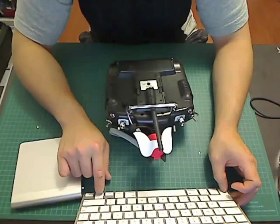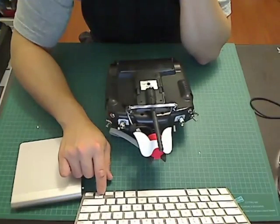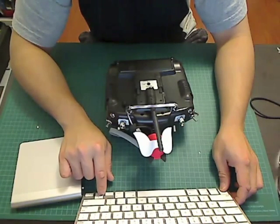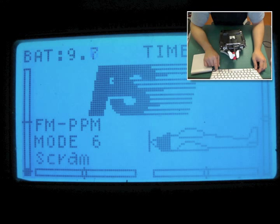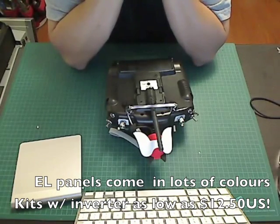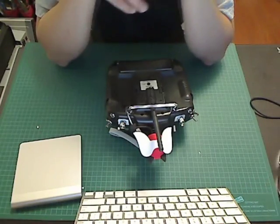Once you're done, put everything back making sure it's tidy and nothing is in the way. Heat shrink everything so nothing gets shorted — or use electrical tape if you don't have heat shrink tubing. Replace the five gold and four black screws on the PCB, then the six black screws for the back cover. Turn it on and you'll have a nicely lit screen — very clean, no more flashlight effect. The mod costs about twenty dollars and all parts can be found on eBay.